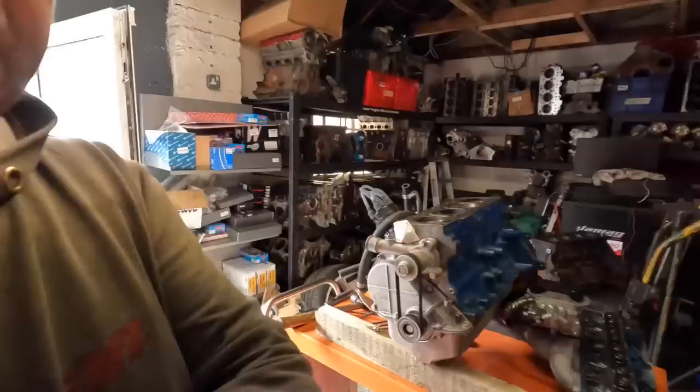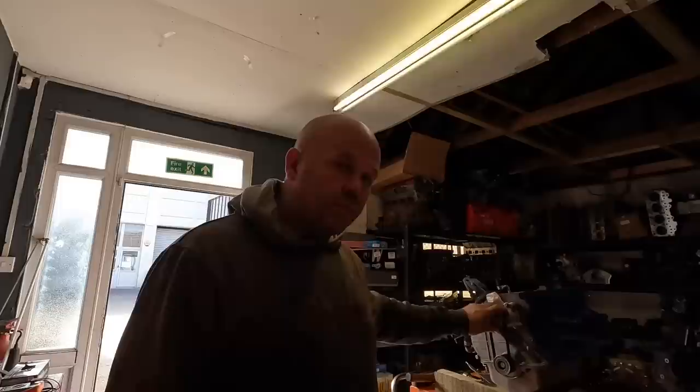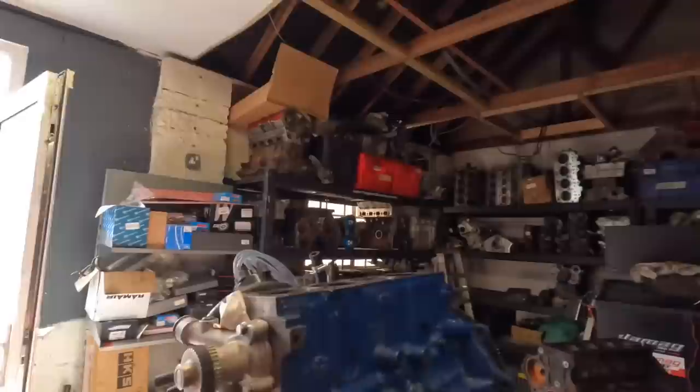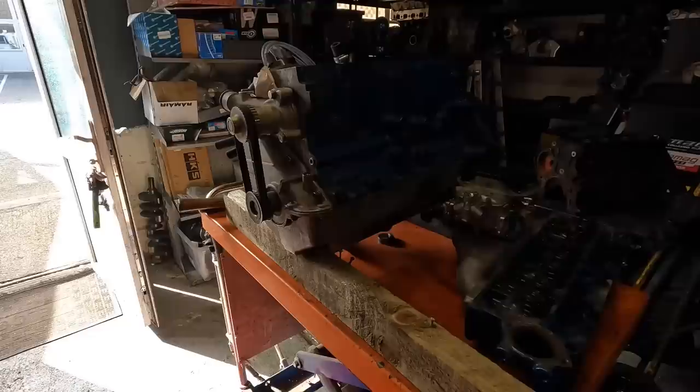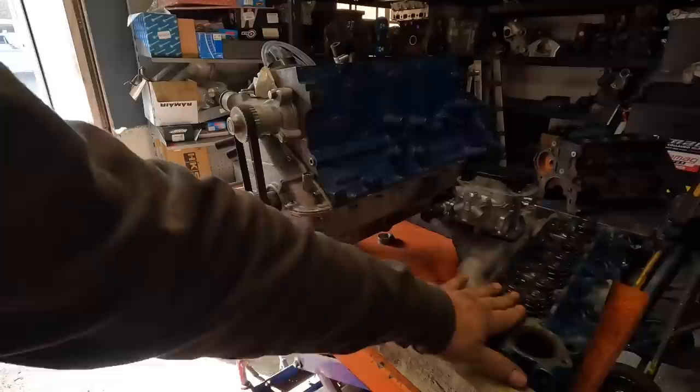This video is for a 1600 crossflow - another engine I'm going to film from start to finish. It's already a race engine for a Formula Ford and it's just a little bit down on power. These things apparently run about 122 horsepower roughly and this one's down at 116. The customer wants me to strip it top and tail it, but before I do that I want to measure everything and make notes using an app on my iPad. I'm going to do a cam timing check, measure the CCs in the block, measure the deck height of the pistons, and measure the height of the valves.